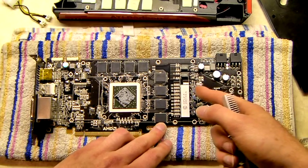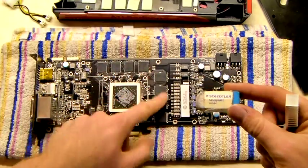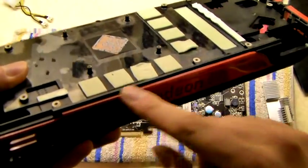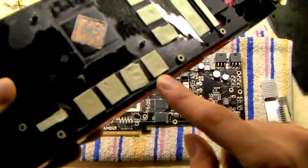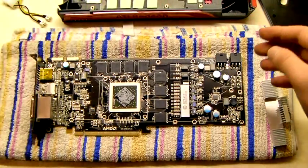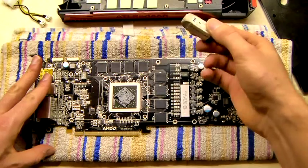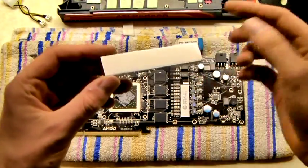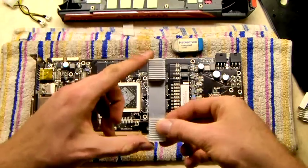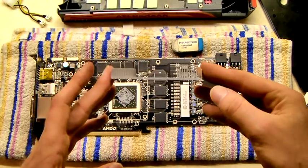Before we can actually do that, as according to the instructions manual, you'll need to use an eraser on each of these chips because on the stock cooler you can see that there are these little pads here and the compound which that leaves behind is quite greasy. So the surface needs to be cleaned with an eraser — just rub the surface on each one to remove any of that compound, and then when you remove the film off the bottom of the heatsink it will actually stick down. Because if you don't do that you're in danger of the heatsinks actually dropping off.